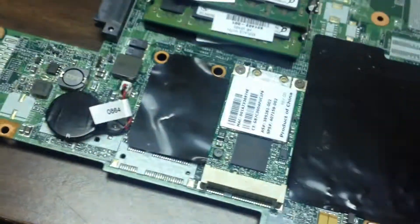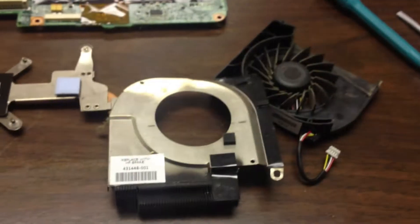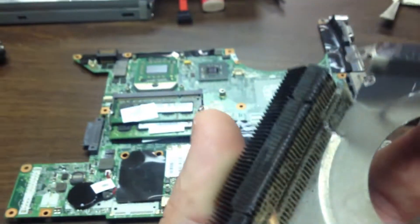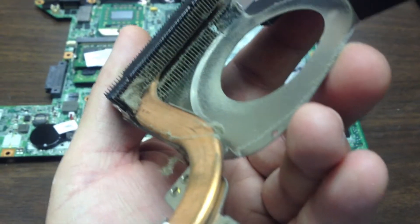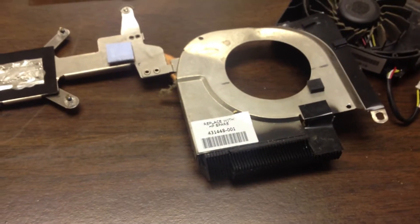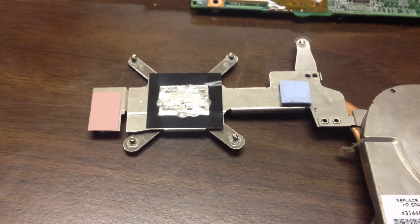We have to take that wireless card out to get to it. What we're going to do is start prepping this system and go from there as far as getting everything set to reflow it. In the first part of prepping our system for repair, we have taken the fan assembly out. We noticed it is a little bit dirty, but on the underside, the fins on the heat sink are the most important parts that we need to clean. No amount of blowing air in there will clean that out, so you need to actually take the system apart, clean that out, and then move to scraping this off and prepping it.